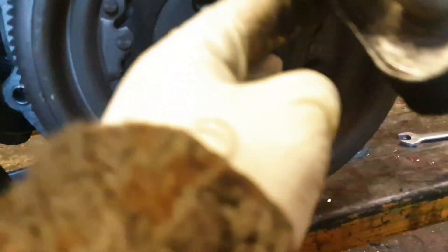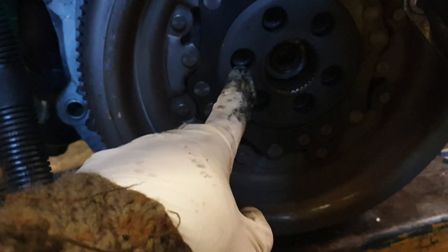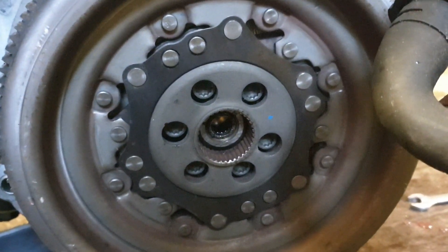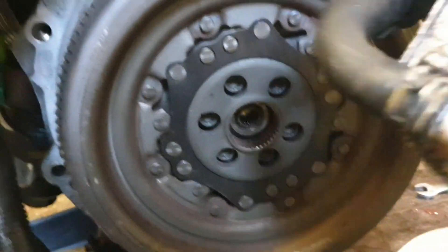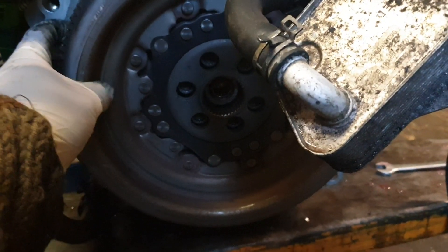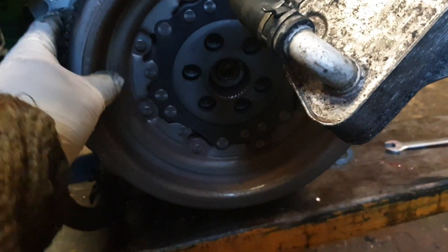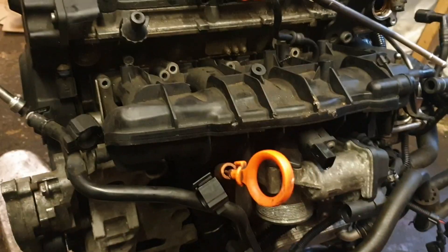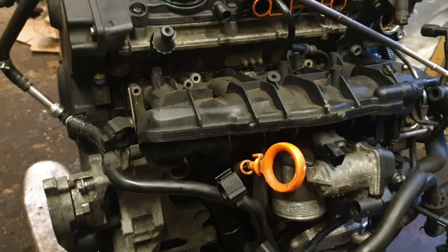Just take off the clutch - it's an M12 I think, or M10 - there are six bolts and you release the flywheel clutch, which you will need for your car. When you buy a block from breakers you don't get anything but a bare engine.